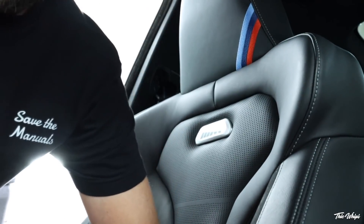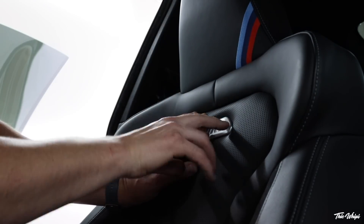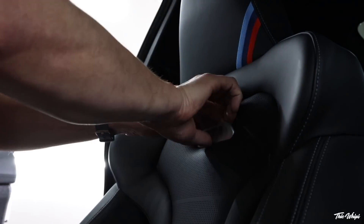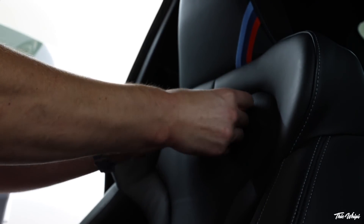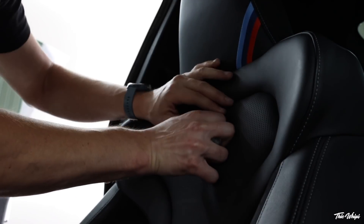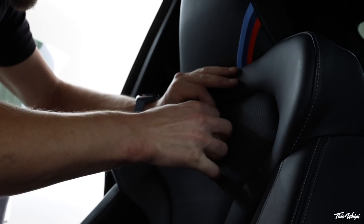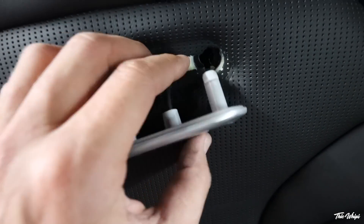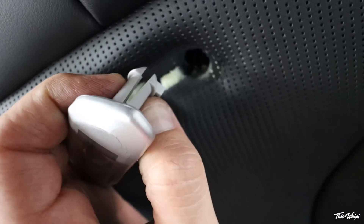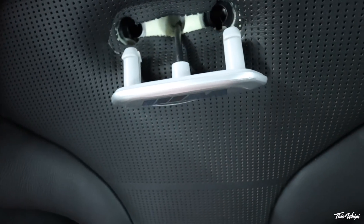This positioning is going to be a little bit awkward, but you're going to have to face the seat. There are two plastic circular clips that go inside of this. We're going to reach in and push down so we can disconnect the clips from the upside and then pull upwards like that. There's going to be a little bit of wire that comes out with this as well — we need a little bit of slack out of this wire, so just pull gently. Basically, stick your fingers in there, push together, then lift up and pull out. You'll be able to feel the clips — it's pretty easy to get out.